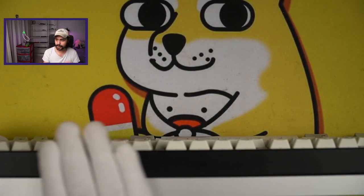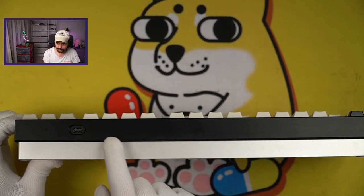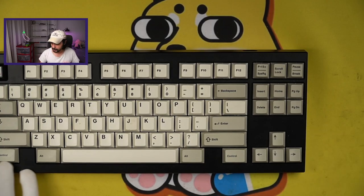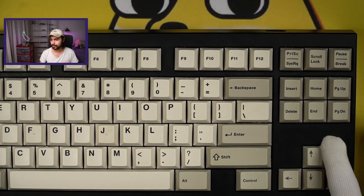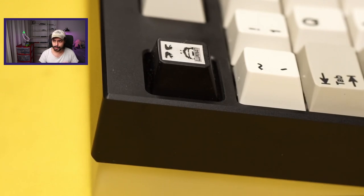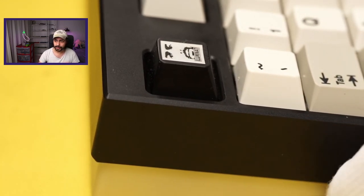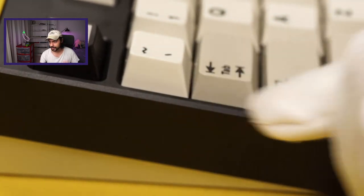The same goes for the black anodization — we can see a little bit of striping going horizontally, which is a little bit noticeable when it curves, but otherwise it looks pretty good. The top case has a few markings in the anodization that are really, really hard to catch on camera. On the macro cam, at the smallest scale it looks fantastic. The chamfers are super well done, and what we're looking for when judging finishing on the edges is no white areas, no little scratches, no issues during the finishing process. It looks pretty darn good all the way through.